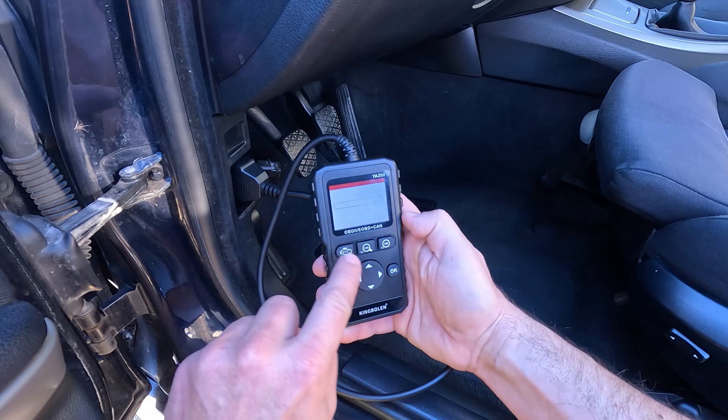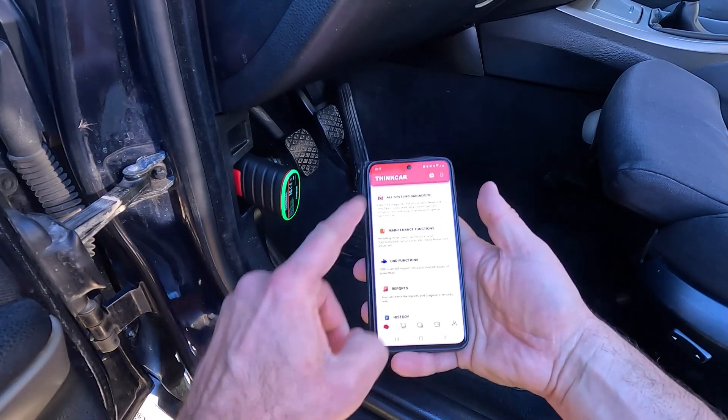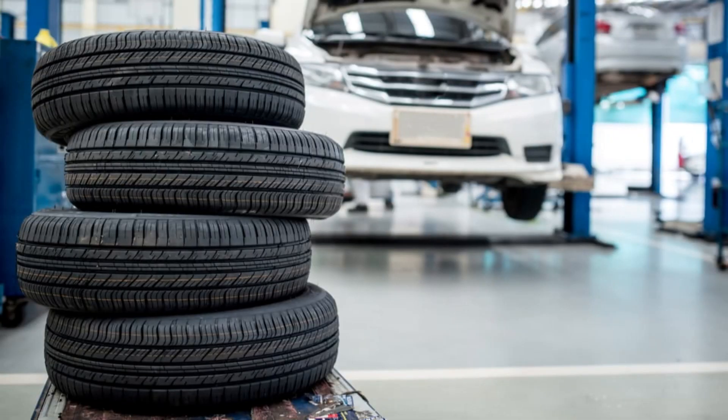If you've adjusted the tire pressure and reset the TPMS but the warning is still on, there's a good chance something's broken — most likely one of the sensors, assuming your car uses that sort of system. I'd suggest checking the trouble codes with a diagnostic tool. Most cheap OBD2 readers won't have the ability to do this, as they only see engine and transmission related stuff. Instead, you'll either need a more powerful device capable of accessing the TPMS system and any codes stored in it, or visit a tire repair shop. If you replaced one or more tire sensors, they will have to be reprogrammed. If the replacement was done at the tire shop, take the car back and ask them to do the job. If not, you may need a reprogramming TPMS tool. However, most automakers include a way to reset and relearn new sensors — you can read more about the procedure in your service manual or do a quick search online with your car model.